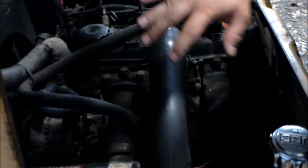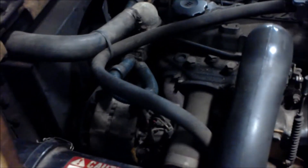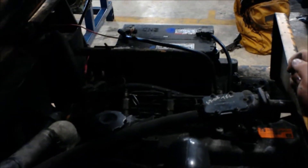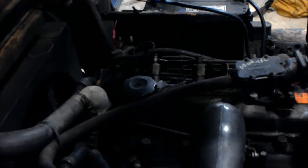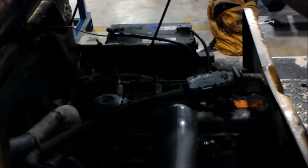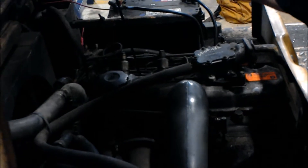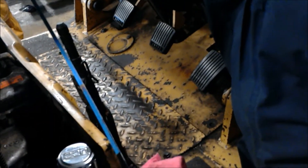This is the overall general inspection of the engine compartment. You want to make sure there's no debris, it's not too dirty, and you want to note any broken wires. Inspect the battery connections. I'm going to go ahead and pull the oil dipstick and check the oil — it looks like we're right in range. The oil on this is good.